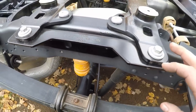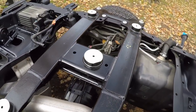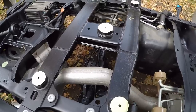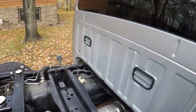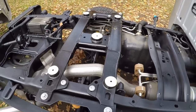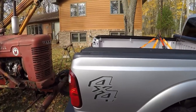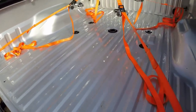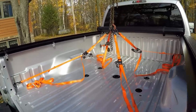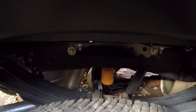With all the bolts just snug enough to hold everything tentatively in position, it's time to put the box back on the frame. I'll slide the hitch around and adjust it as needed, and also adjust the box back to the cab to get everything centered and find the ideal position before tightening everything down permanently. I got the box set back on the frame and I'm happy with the alignment of all the pucks where they stick up through the holes I drilled, so it's time to lift the box one last time, gain some clearance around the hitch, and give all the fasteners the final torque.